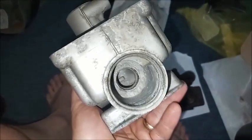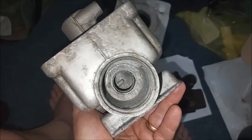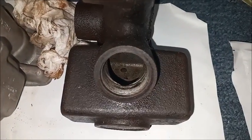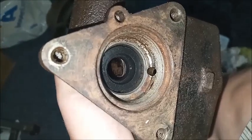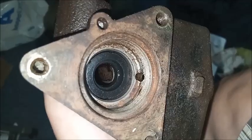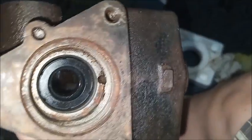The reservoir and the cylinder itself are separated by a compensating valve, which goes in that. The Delco Moraine doesn't have such a valve. You can see the hole, which is the passageway from the reservoir over to the cylinder, and again, that's blocked by a seal when the brakes are being applied. When the brakes are released, the plunger is back enough behind the seal so that the holes in the side of the plunger allow fluid through. So there's the hole over to the reservoir.